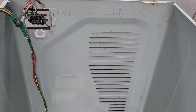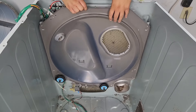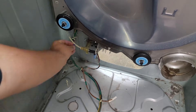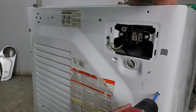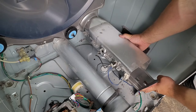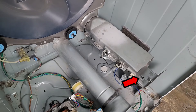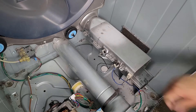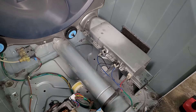To reinstall the bulkhead, make sure it slides into and rests on the two tabs at the top of the chassis — this part goes pretty easily. You can then reinsert the water line into the steam port and put the blue clip back in place. Once you have this all in place, reattach the six screws on the rear of the unit to secure the bulkhead fully back in place. To reinstall the canister, slot it into the back of the tabs on the rear bulkhead and set it on the canister stool, then put the single Phillips head screw back into the canister stool to secure it. Reinstall the red and blue wires going to the element canister and the disassembly and reassembly is completed.